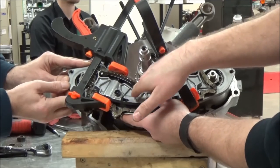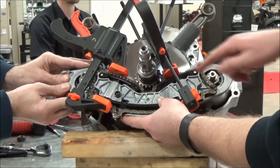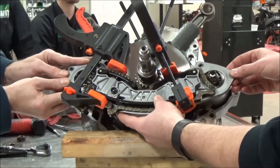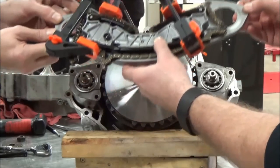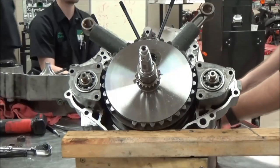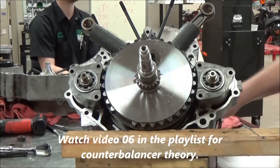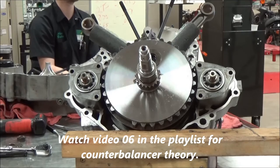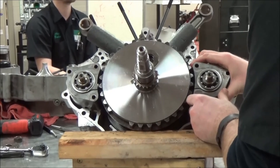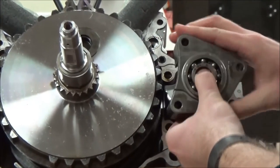With the bolts out, this will drop down because we're off the center of the balancer shafts. The chain will free itself from the crankshaft — this isn't heavy. Brinch is helping me so it doesn't spring apart. We'll just set this off to the side. I've already shown you in a previous video what those components look like, so I'm not going to worry about that right now.